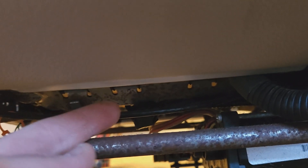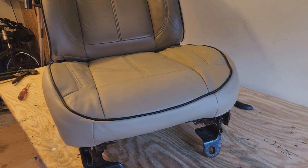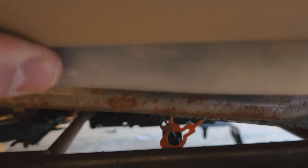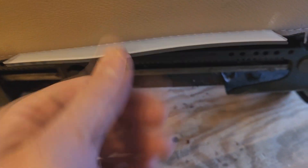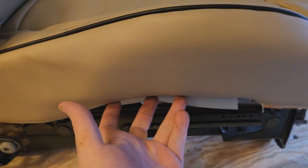It wasn't terribly hard but you do have to give it a considerable amount of force to crush the seat down so it has enough slack to plug into its little mounting point here. Now this seat is basically looking done, but there are a few more things to do. On this side, this holder is meant to go upside down and plug into these two holes — held on by retaining clips. All we're going to do to reattach these is flip it upside down, line it up with the holes in the seat, drill through with the same diameter, then push in the clips and hold the seat in place — everything will be perfect on that side.